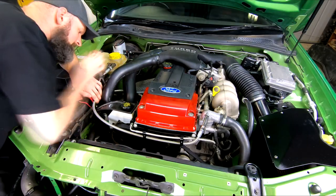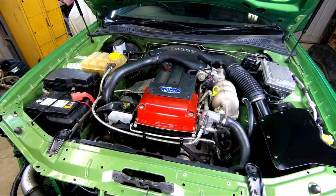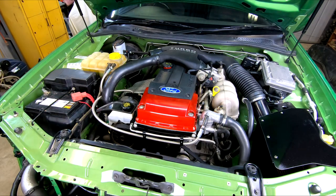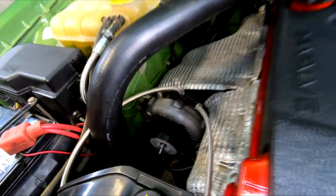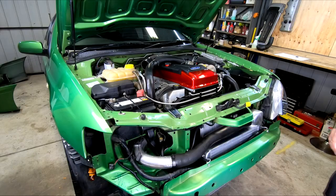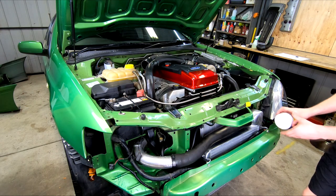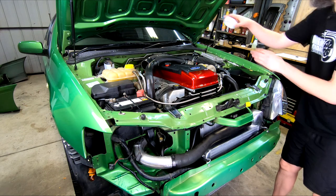again in the future. The intake piping is removed from the front of the turbo compressor and placed out of the way for now. Our cap has been fit flush into the joiner to help stop this flying off under pressure, and can then replace the intake piping on the front of the turbo with the hose clamps nice and tight. Depending on your situation, you may also want another one of these caps as a blank to isolate different sections to test, say just up to the intercooler or to the throttle body.